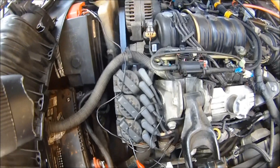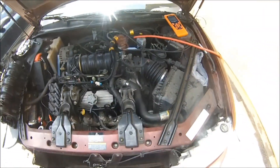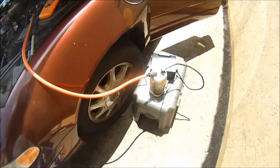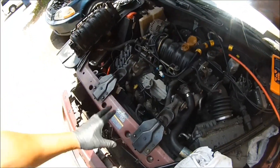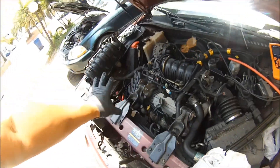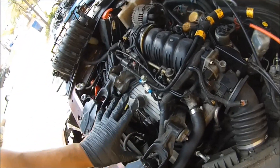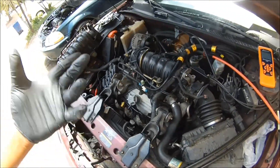That's what you do when you get those two codes — you do a vacuum leak test with your homemade vacuum tester. The smoke test is done. We couldn't find anything externally except for that little stuff, which is not the problem. Now the question is: do we have too much air going into bank one, or do we have too little fuel going into bank one?